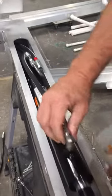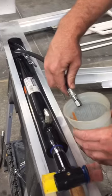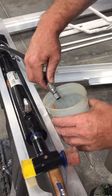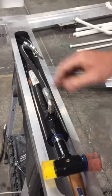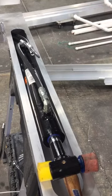The next line will be here. You'll disconnect this line and do the same thing — you're going to wait for clear, constant fluid. It only takes a couple seconds, so don't hold it down more than a few seconds. Put the pipe back on and secure it. Once you're done, you should be able to operate this piston and you should have already completed the bleeding of these lines.